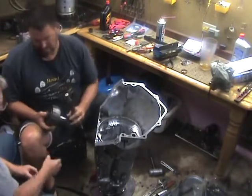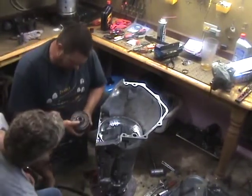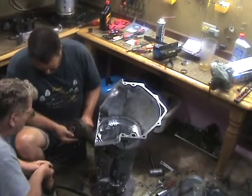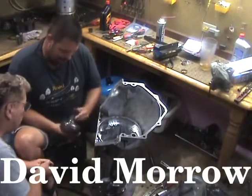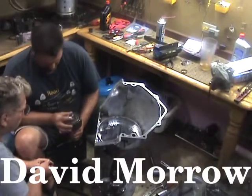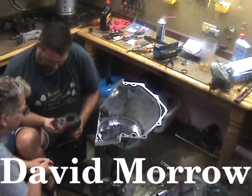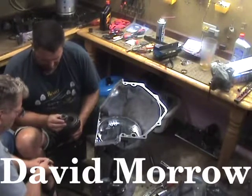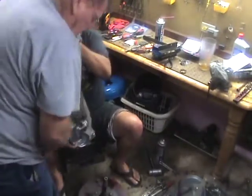Now, like I said, I'm just checking this out. The top bushings in this new piece that we got here that is in that gear, you can see there's two bushings in there, but that's removable. You can take that one out. So we had two there. We had two in the actual, I'm not sure if that's the planetary gear or sun gear. I don't think it's the sun gear. I think it's a planetary gear. But when I took that gear out, there's another two bushings that were in there. We just decided that the whole thing needed new bushings. We had a bushing kit that we bought, and we basically started putting them in. You can see my other videos where I did that.